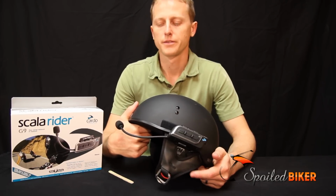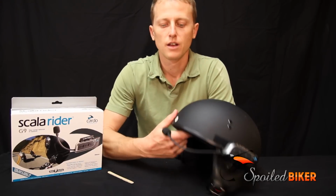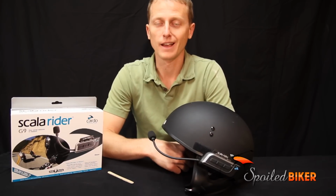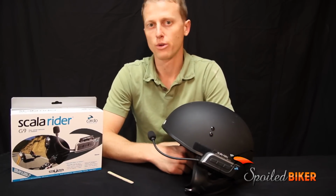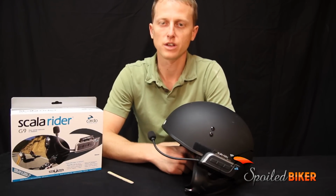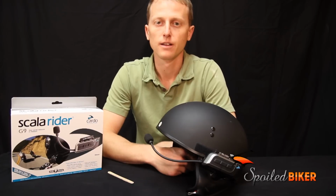So what should you expect? Don't expect it to be as good as the full face experience. Since the Cardo G9 is more of a premium intercom, it has larger speakers, it has a lot of volume, it can overcome a lot of the wind noise, but if you're listening to music, you'll enjoy it at about 45 miles an hour. At 60 miles an hour, you're only going to be hearing the percussion part or the higher parts of the music. You won't hear the full spectrum, and the enjoyment for music at 60 miles an hour with this type of helmet is just not that great.